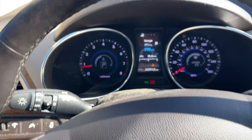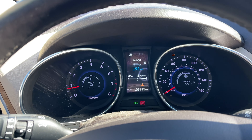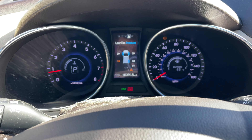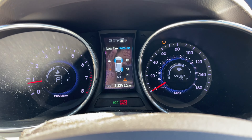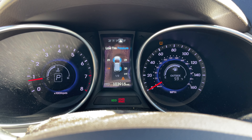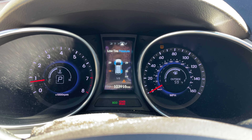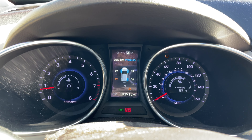To figure out what that warning light means, we go to our little menu here. We're going to hit this button until the cursor on the top moves to the warning light — hit it once, one more time, one more time — and there it goes. It's telling us that that little triangle means low tire pressure, and we can see that our left rear tire is at 19 PSI. I'm going to go ahead and fill it back up to 35 — they should all be at 34 to 35.